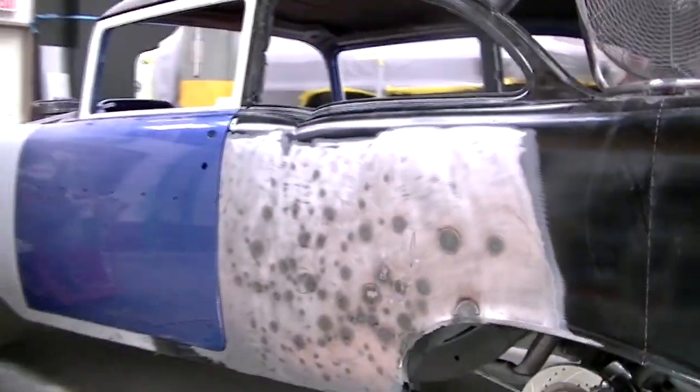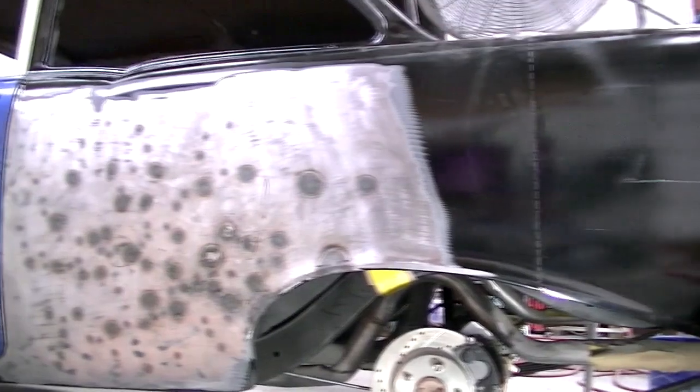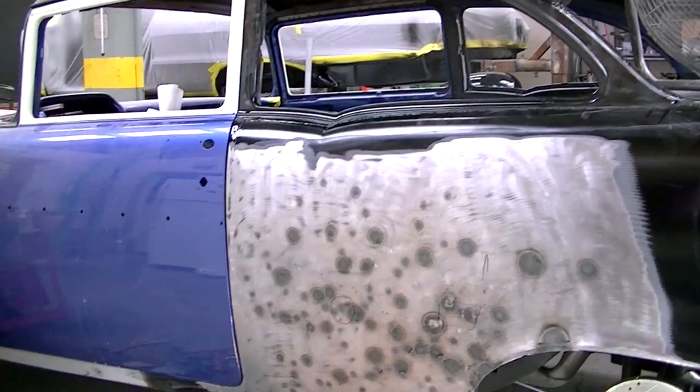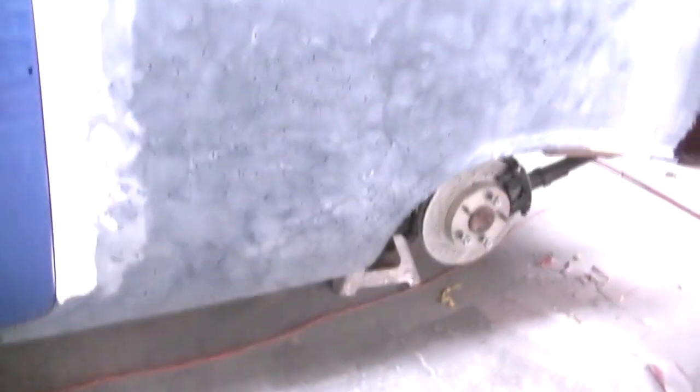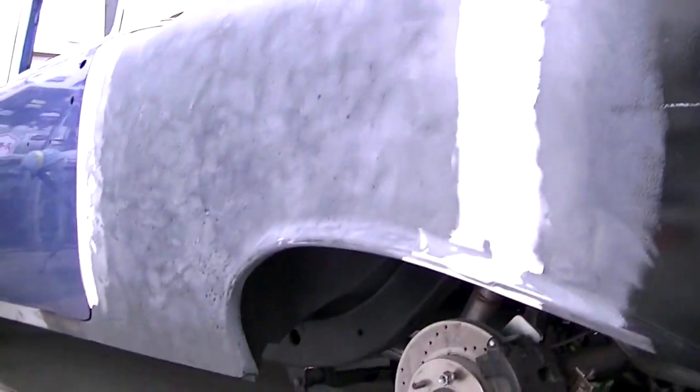Now we can see here that I've done extensive heat shrinking on that quarter panel. Both quarter panels were the same. They were both fat by either them being replacement parts, welding techniques, whatever it was that made it. We needed to address that. Here I started by, we reprimed the quarter panel after all that shrinking, and gapped that door to the quarter panel to start it out with, and also welded up this seam back here and put some filler there to get the overall shape started.